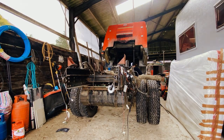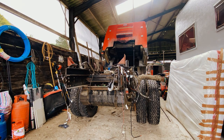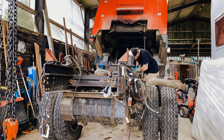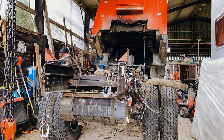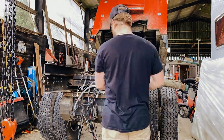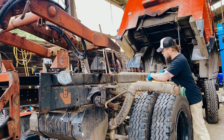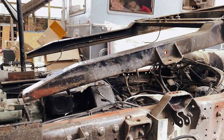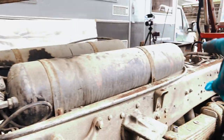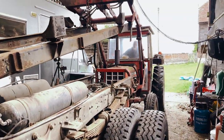Removing the subframe was a little bit tricky. The bolts were fairly worn and rusty — seized really, not heavily corroded, but just rusted and seized. It took a bit of work to get to them and they're in awkward places — tiny little brackets where you could barely even get a ring and flat spanner onto them, let alone a rattle gun or socket. One of them I had to cut with an angle grinder, but we got there in the end. The subframe is now off and on the tractor, ready to back out of here.